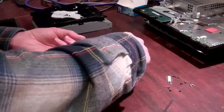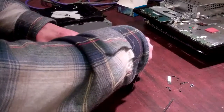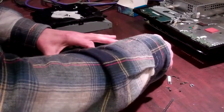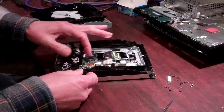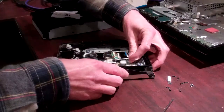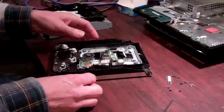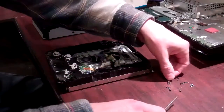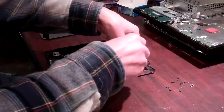Once you've inserted your replacement laser, you're going to reverse the process. Push the front of the bar down until it goes under the clip, and then lift it so that it comes into place and hits the front stop. Then take your rear and pop it back into place so that it's secure, and reattach the clip that you removed to get access to that bar.